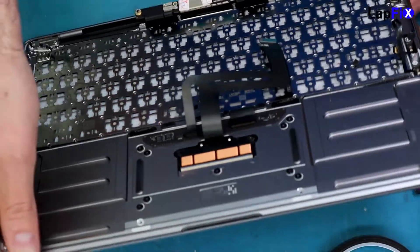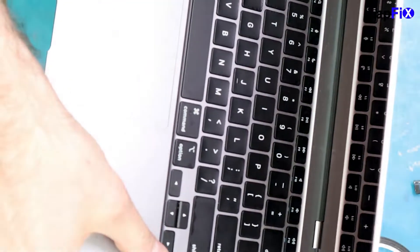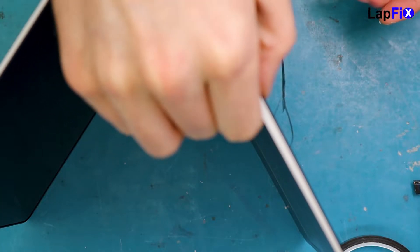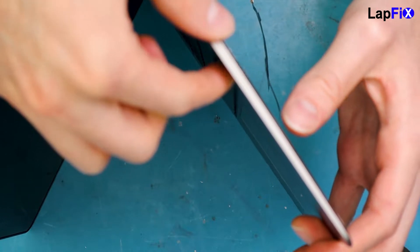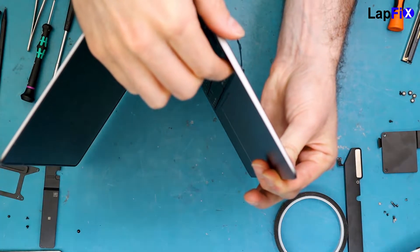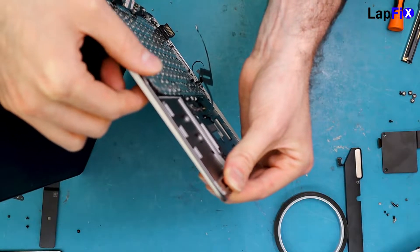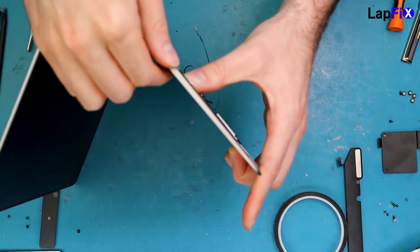The good thing is the sides were covered with screws. But when you type individual keys, the key will push down more without a stub holding it. Let me show you — on this side where we already worked, this button is pushed in and will fall through when pressed. But on the side with the screw still in, when you tap it, it's totally fine and will work correctly.